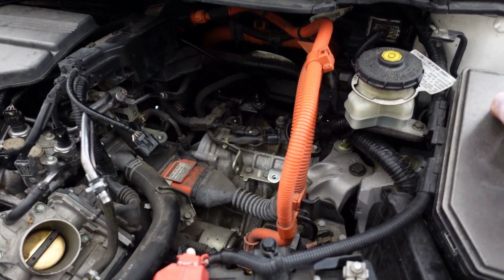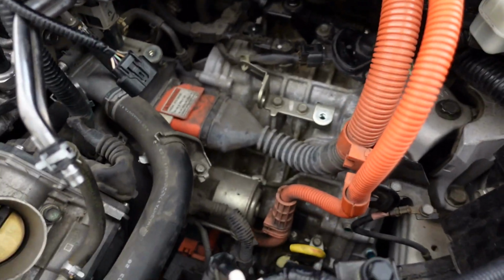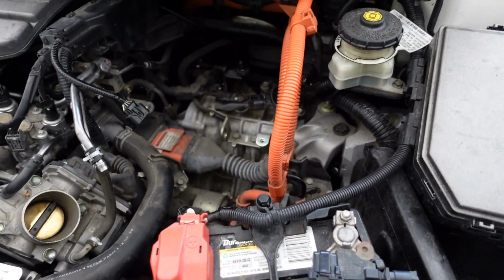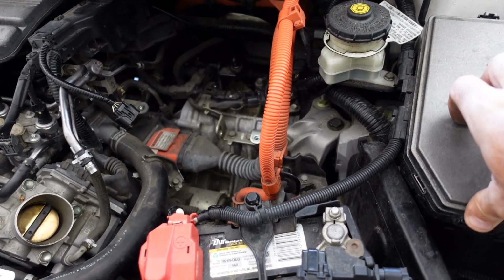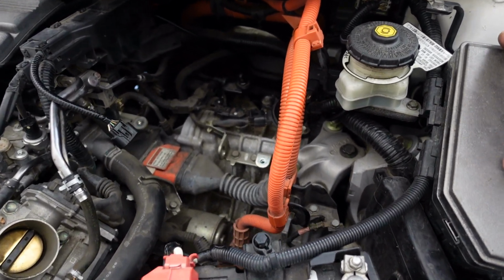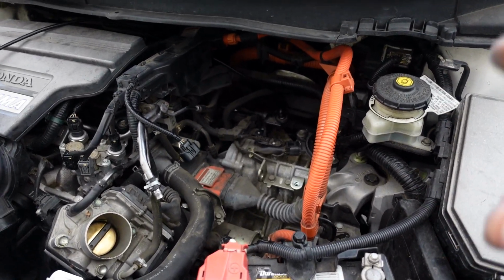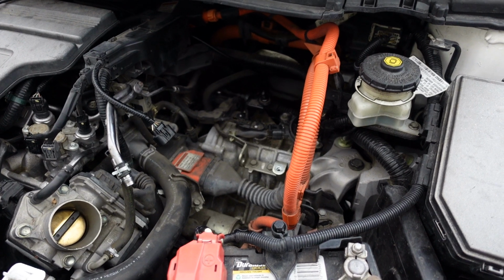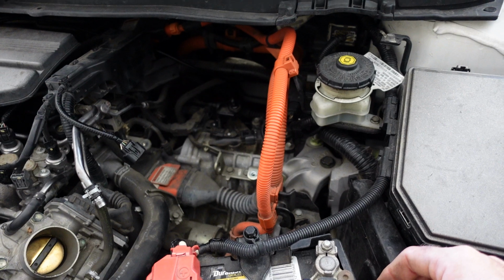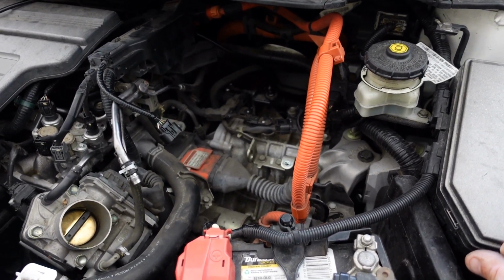This trans is going to have to come out. So we're going to learn some more things. Luckily, it's kind of tiny. It's not that bad. But yeah, this trans is going to have to come out. And if it's just that bearing, if I can get a replacement bearing for $100 or whatever, man, I will consider myself extremely lucky that that's all that it is. But I believe that we have a bearing failure on this gear that the shaft reads, and that has taken out the sensors. So I guess that's my final update before we start tearing the thing apart.